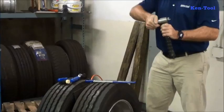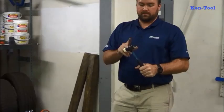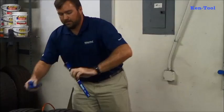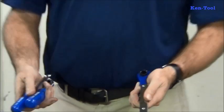Some more specialty products: we have our heavy-duty wheel weight hammer with a removable face and removable hook, for clip-on weights on light truck all the way up to heavy truck. We also have an automotive-grade wheel weight hammer with the same features — replaceable hook and replaceable face. And this is an offering of brake slack adjusters: in my right hand for the Meritor system, in my left hand for the Haldex system. These are to adjust the brake S-cam slack for drum brakes on heavy-duty trucks.